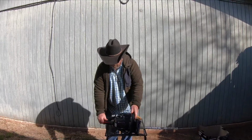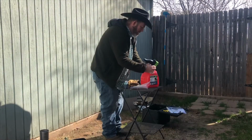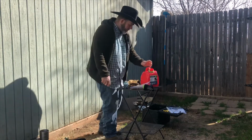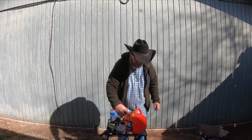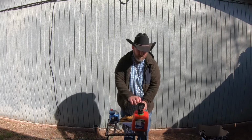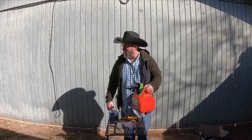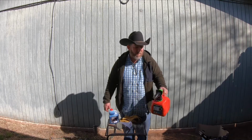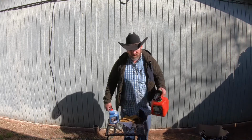Alright, so what I'm going to do now, I'm going to go ahead and mix up my fuel, 50 to 1. You just tear that off. Of course, you're going to probably get a little on you. Pour that into your gasoline. I'm going to go ahead and shake it up some. Mix that oil in, because, like I say, I put the oil in on top of the gas instead of the gas in on top of the oil. A few good shakings should do it.